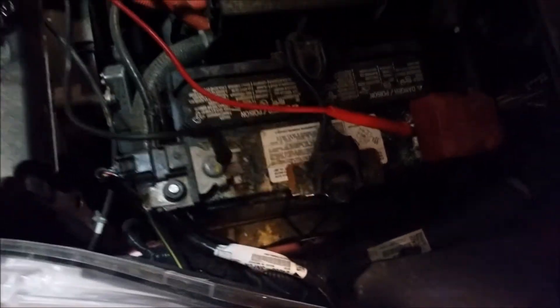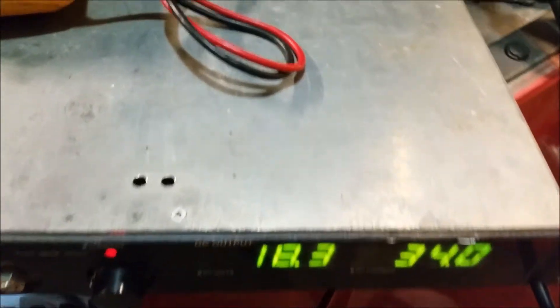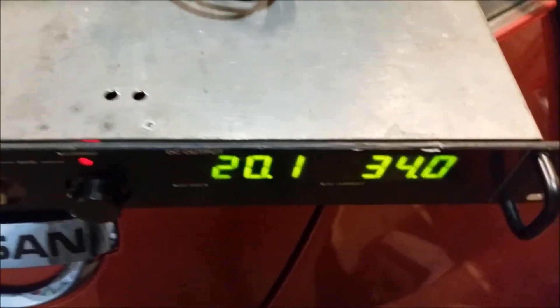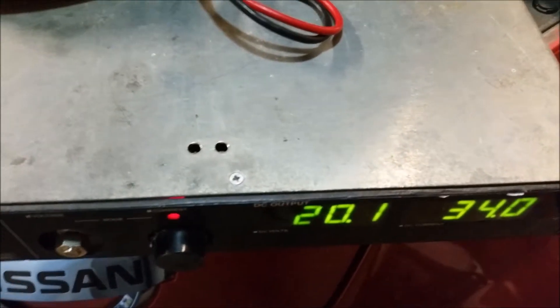This is my first cycle. You can see the battery is 11.92 volts — it will not turn the car on; there's not a lot of cranking amps. Here's my DCS3333, basically a rack power supply. It puts out 34 amps and I've got it set to max out either voltage or current. What this does is it pumps a significant amount of current into the battery, heating the battery up and causing the sulfation to fall off the plates — for lack of better terms, you're kind of cooking the battery. You'll start seeing a little bit of bubbles, and later on this seriously starts bubbling — that's the reaction occurring and it's bringing the battery back to life. The more current you can pump into the battery, the better it is to reduce the sulfation on the cells.